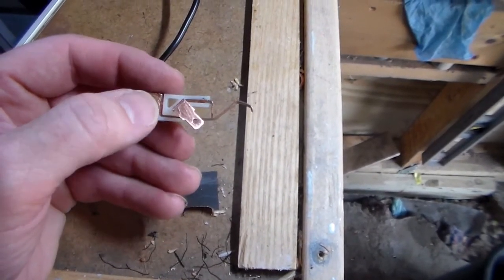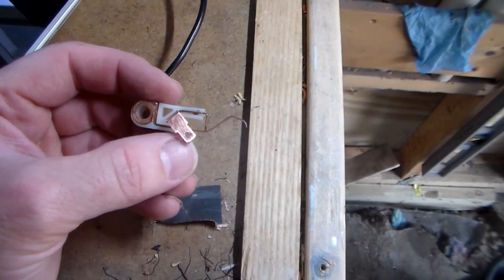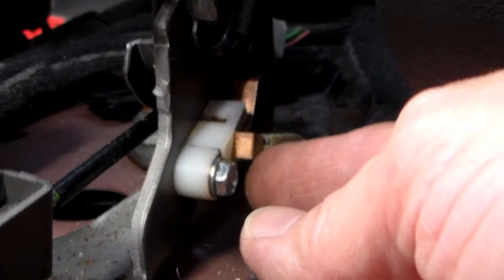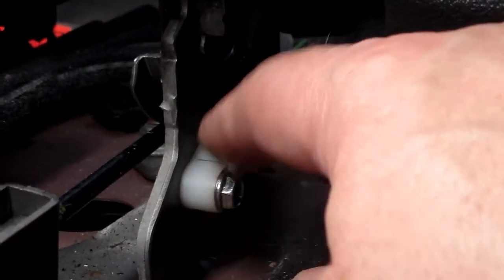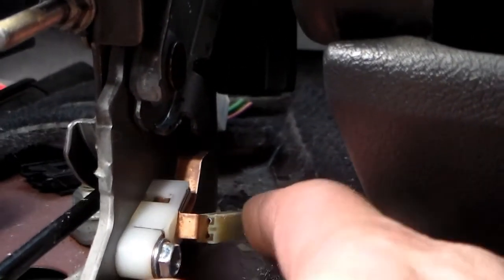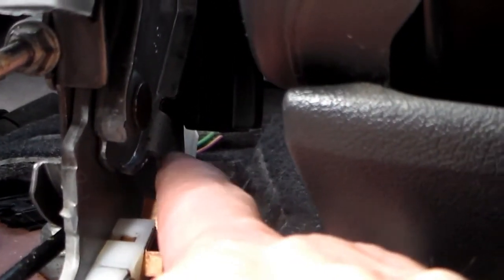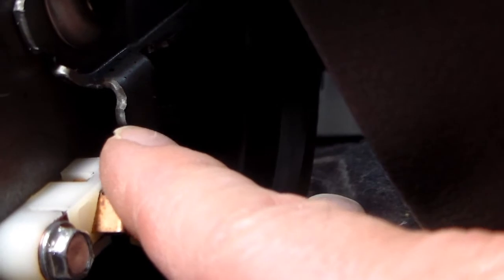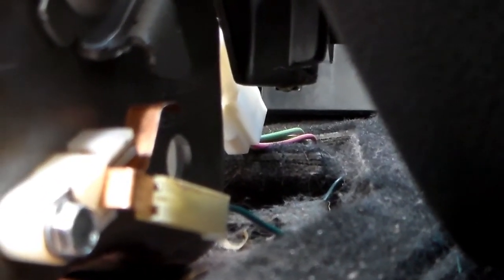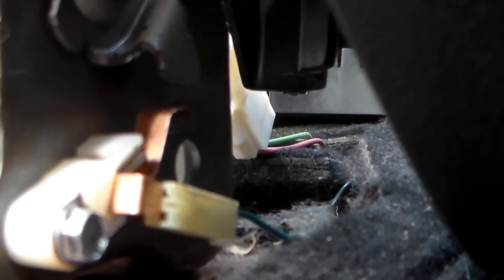I've removed the oil I found in the area where the screw goes and cleaned up the contacts with some fine grit sandpaper. Now this is the base of your parking brake — here's where the switch goes. It's held in with one 8mm bolt and there's a plastic locator pin with a corresponding hole in the base. Tighten that in, but don't over-tighten it because you don't want to crack the plastic. Your electrical connection attaches right here to that spade connection. When I lower the parking brake lever, you can see it pushes down on that contact and separates it from the one that goes to the computer. When I pull it back up, it brings the two contact points back together and grounds out the wire, telling the computer the parking brake is on.